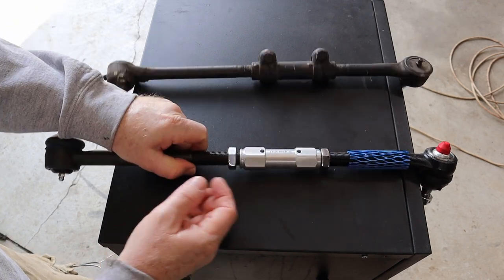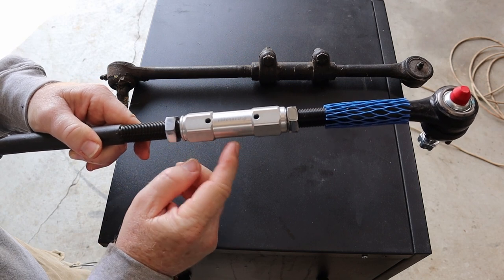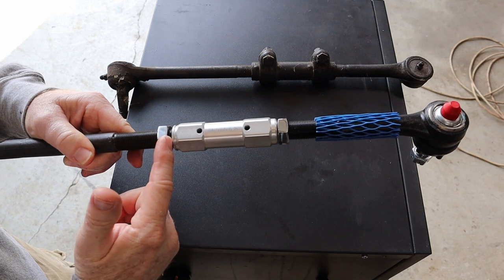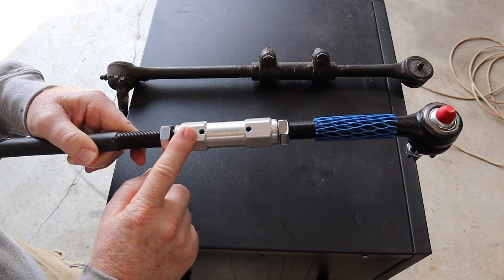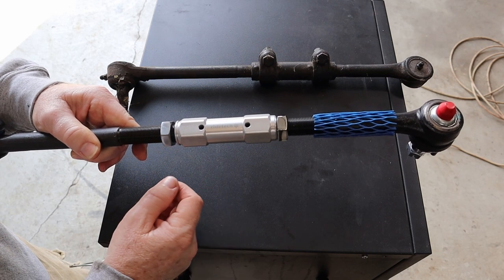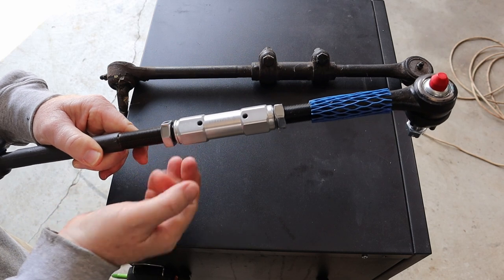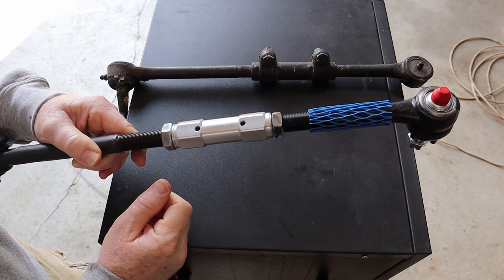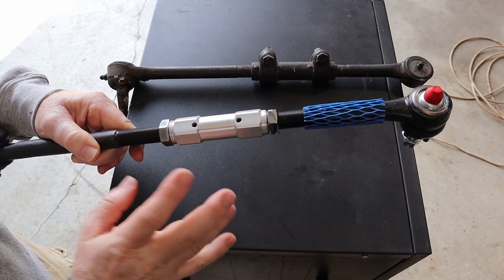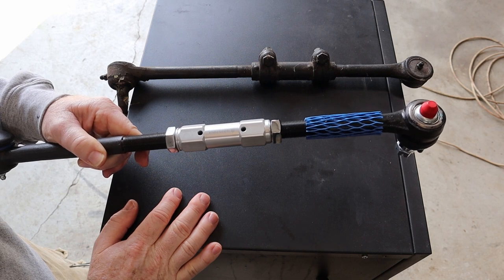And then the new one is actually bolt-on sleeves that screw on. They are reverse threaded on the inner tie rod. These are by Ridetech. CPP makes them. A couple other manufacturers make them. But much better design. You've got your jam nut here. Tighten everything up based on the length. And it's going to look much, much nicer. So excited to finally get these on the truck and then get Harold back on the ground.